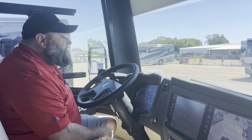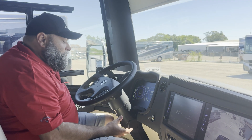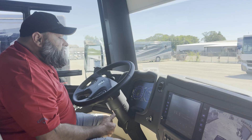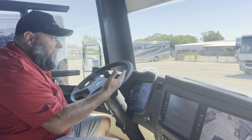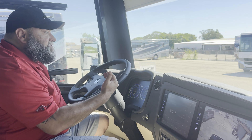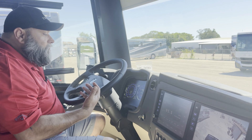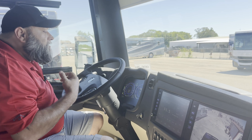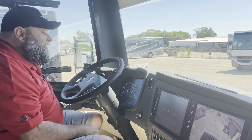On the new system, one thing a lot of people have asked about is the new adaptive cruise control. It has three settings: long distance, medium distance, and short distance. Long distance keeps multiple car lengths between you and the object in front while cruising; medium shortens that distance a bit; short gives the least distance — whether that's another car, a truck, or the coach in front of you when caravanning. You can also disable adaptive cruise from here.